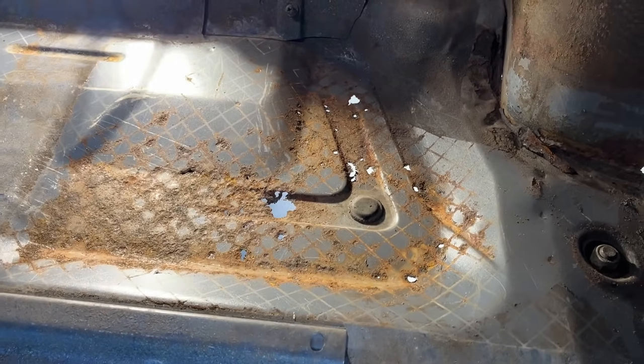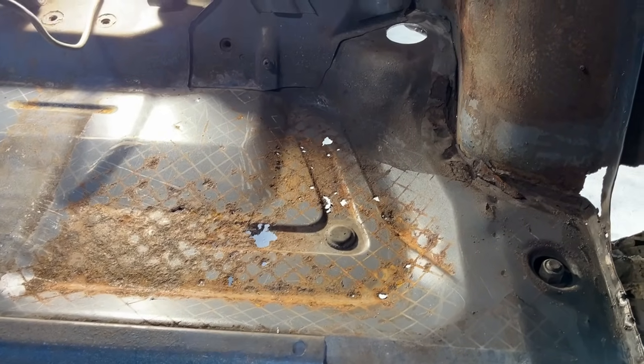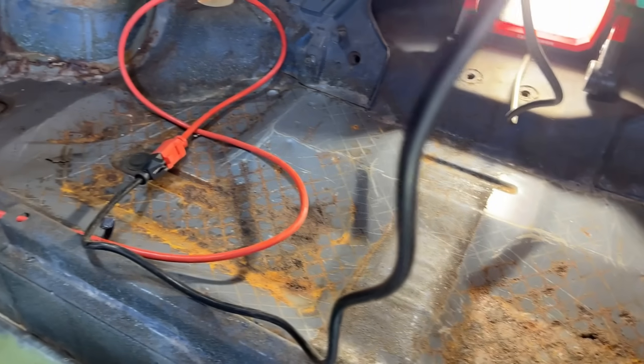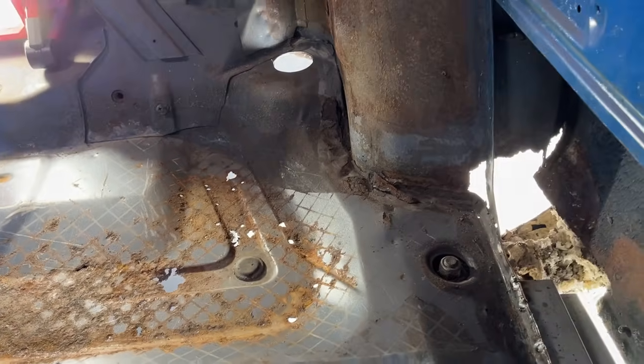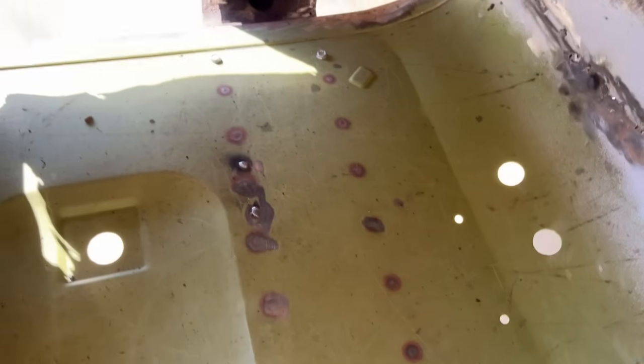I still have to fix that. You can buy these rear parts of the car in two pieces, so I'll probably buy one and just cut out the bad parts for both sides. Still a lot of work to do on that. I started in the middle here, and you can see this metal is so thin it just blows holes through it. The under pan that goes underneath here is in, and I plug welded those.